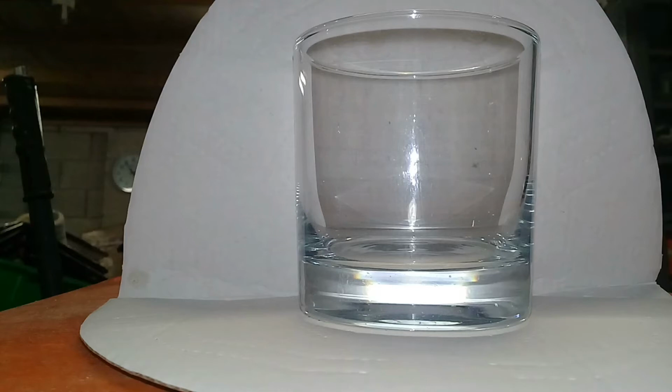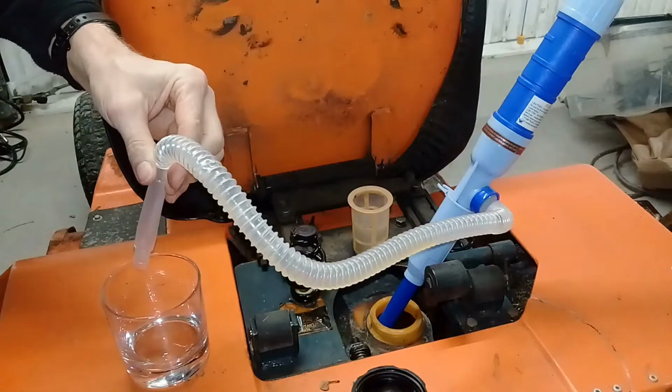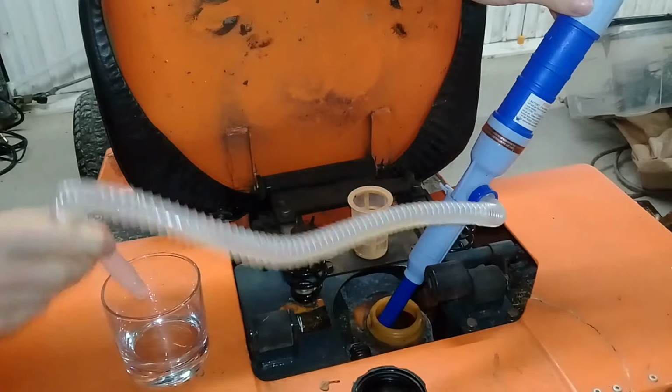Right, so in this video, we're revisiting the two-stroke in diesel. And in this particular look at this mixture, we want to know, does it stay mixed, this two-stroke and diesel? Does it stay together, or will the two-stroke just separate and drop to the bottom?